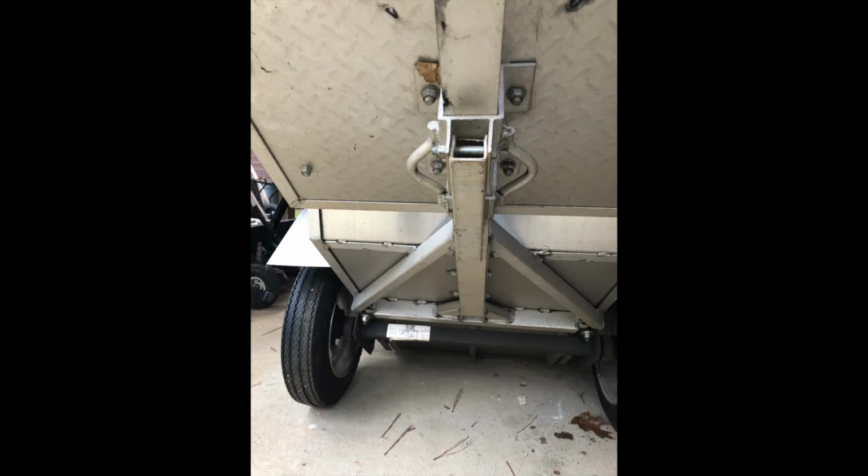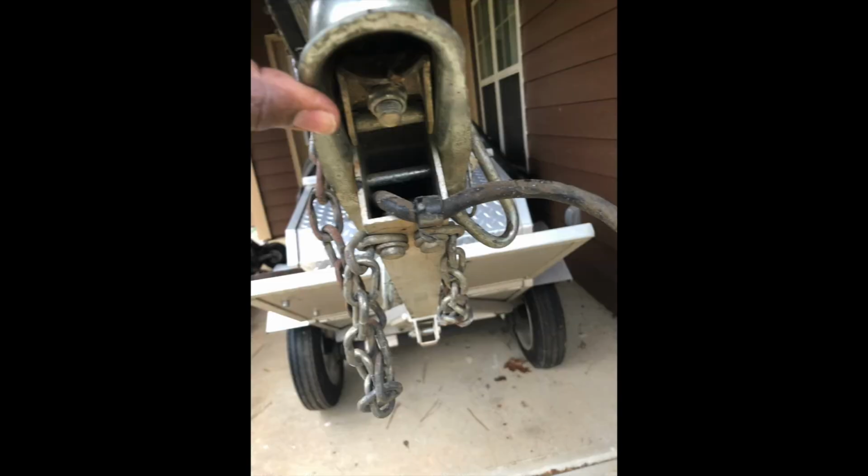I found a location underneath the trailer to put my lights on the frame and then hide the module between the frame and the rest of the body to keep it from getting hit by water. Then I ran my main wires, after I tapped into the wires up front, through these channels to come to the back to feed the module.